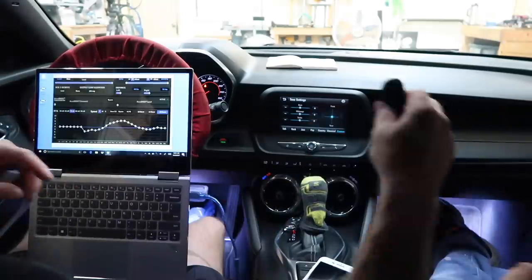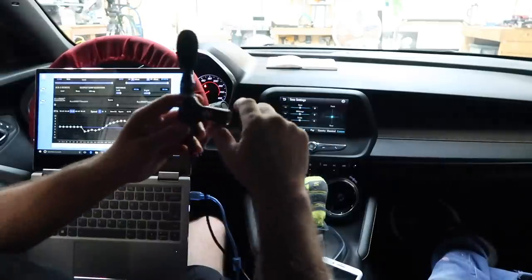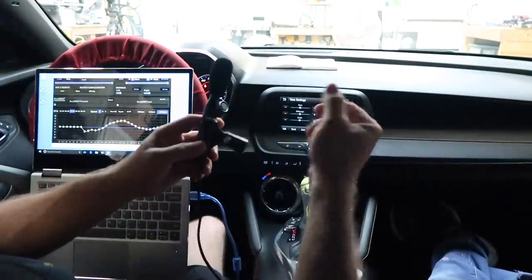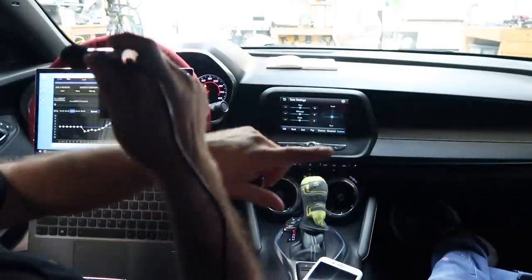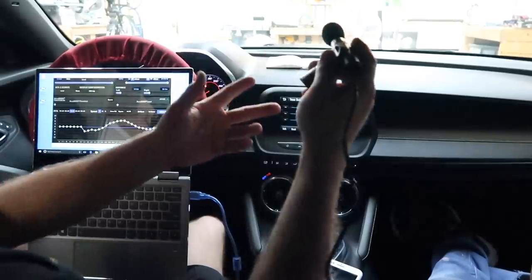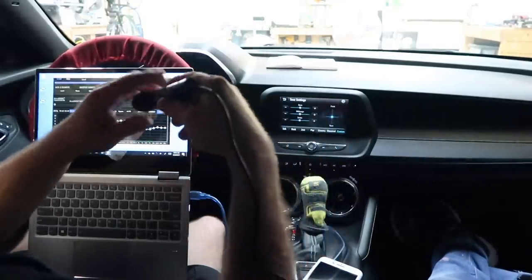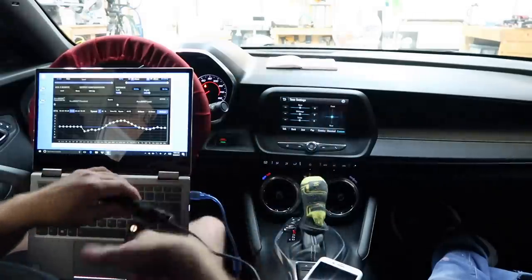Now, Audio Control makes this guy right here, which is the iTest mic. These are really cool because you can use your iPhone or iPad. It is only for an iDevice, I'm sorry. You can mount this right where your head goes and use your phone as the RTA. Obviously an iPad is a little bigger. If you guys have watched these videos, we have shown this before. You just download the Audio Control app, plug it in, and you have yourself a great little RTA